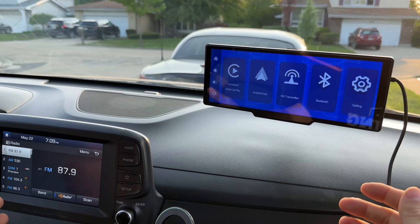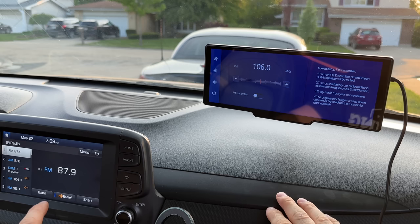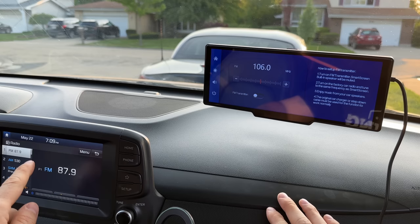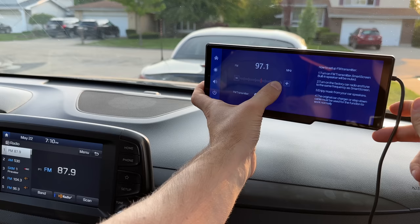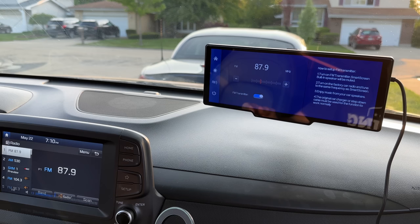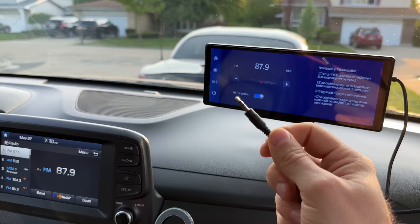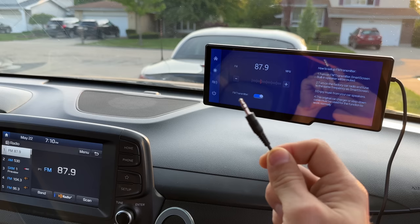How would we connect this device using the FM transmitter? That's pretty simple as well. On the device, we're going to go to FM transmitter. At the moment it's turned off. I have set the car to 87.9 — seems like there's nothing happening on that one, so we just tuned into an unused frequency. Now I'm going to do the same on this device, so we're going to go to 87.9. There it is. Turn the volume up and turn the FM transmitter on. And look at that — we are now listening to our phone's audio through the FM transmitter wirelessly. The auxiliary cable is still unplugged and the audio is coming through the car. Honestly, I am very impressed. The audio is very crisp; it's basically just as good as through the cable. Maybe even a little bit better.